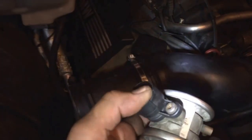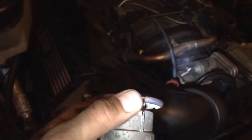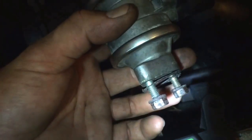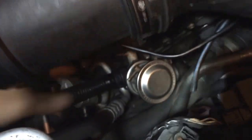Your air pump hooks up to this hose, to this connection right here. And then you have the pneumatic vacuum line that hooks up here — it comes from the top, right here. It's down there, and it's a really kind of confined space down there when you want to get the back nut off. Because there are nuts that you have to take off to get it out, and it's kind of weird and confined in there to get a wrench in.